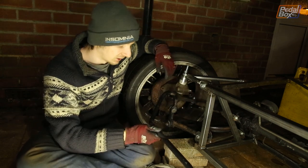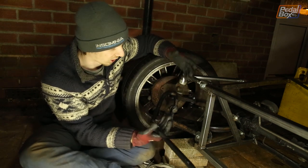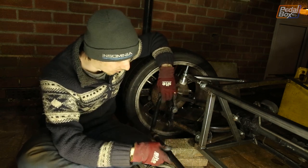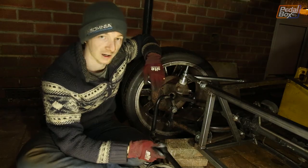There is a little bit of margin for error here. You can go a little bit lower, which a lot of manufacturers do because it gives you easier access from underneath. You can go a little bit higher, but there's not really many good reasons to do that usually. We're probably going to go lower just to get around the radiator and things, but we can at least get a lot closer this way around than we could if it was mounted above the power steering rack.